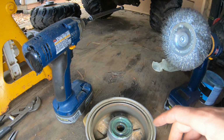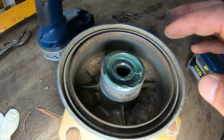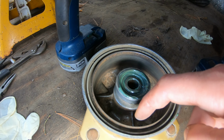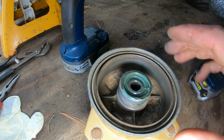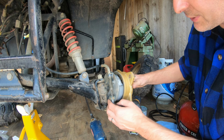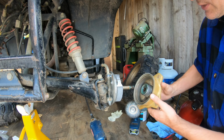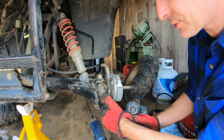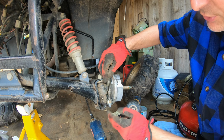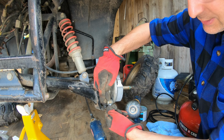So from here, you see I have been packing the bearings with grease, cleaned everything up in here as best I could. I used a, you know, hand sanded with 100 grit inside here, and then air blast everything out. So we're as clean as we're gonna get. So I'm gonna put it back on real tight. Might actually be too tight. Make sure this is actually pulled all the way down. I'm actually gonna thread it. I was at the bottom, but I want to get this bar down.